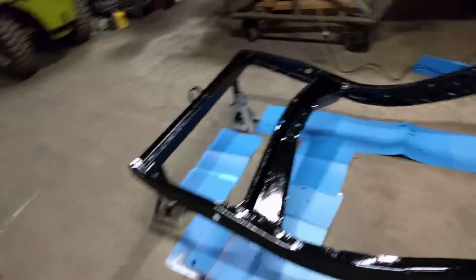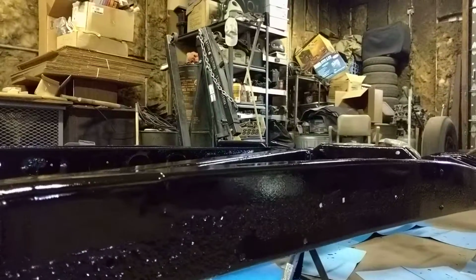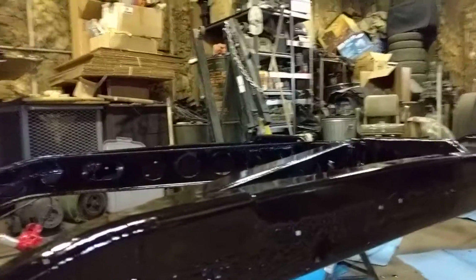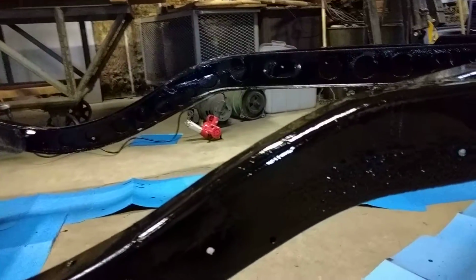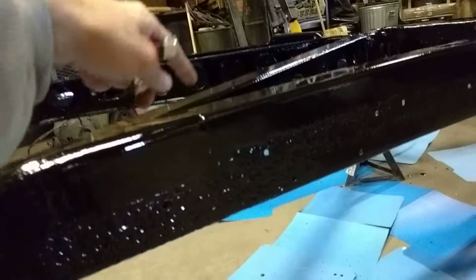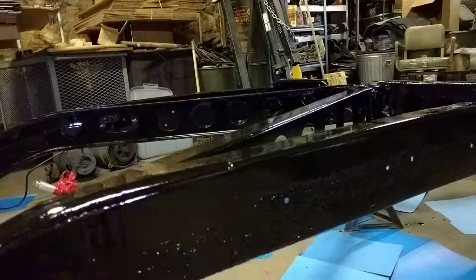What I do think I'll do, though, is you can still see, like, the pitting in it. I've said before, it's not all the way through, but it's substantial. I'm still pretty set on boxing in the frame. Really, what I want to do is get all this stuff into the cracks, like behind all those little holes over there. But once that's done, welding will obviously burn off probably a little bit. I mean, if I can keep the heat down, it'll keep the heat from burning too much of the paint off on the inside.